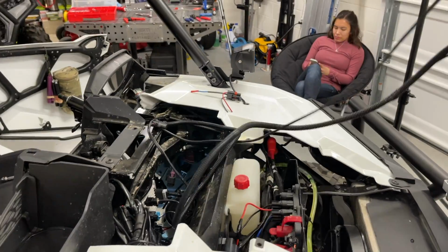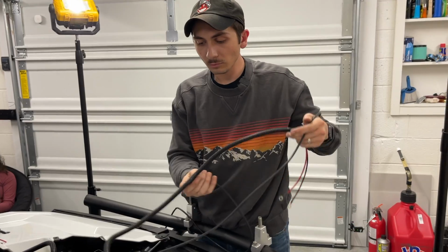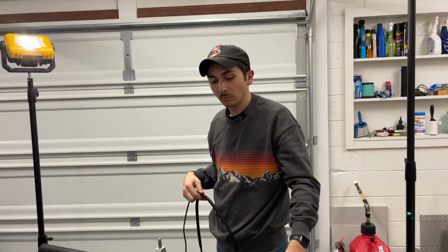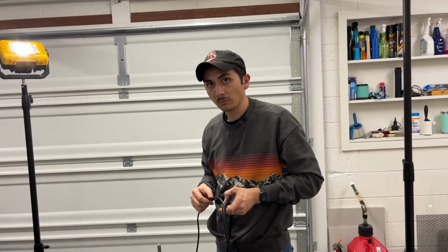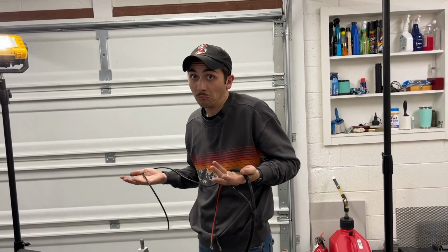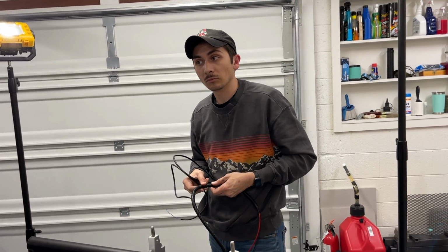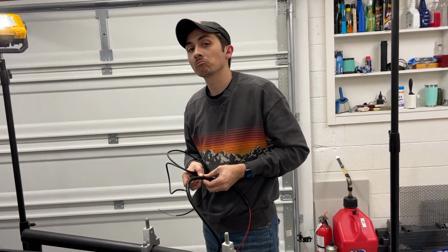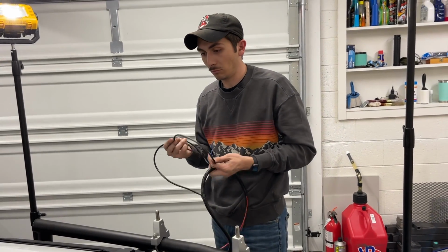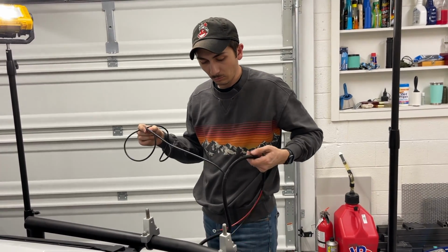Now one thing I will say, the white wire is going to have to come with us. Now one thing I will say, Nate, is my RZR, which does have power steering, is not speed rated. In other words, the steering is the same whether you're going 10 or 50. On other units like an XP1000, I know the steering slows down as you speed up. That could be what that blue wire is, and because it's not affected on this machine, it wouldn't be in the instructions, because the instructions are specific. Could be, yeah. So that's probably what it is, but we're going to keep moving forward.